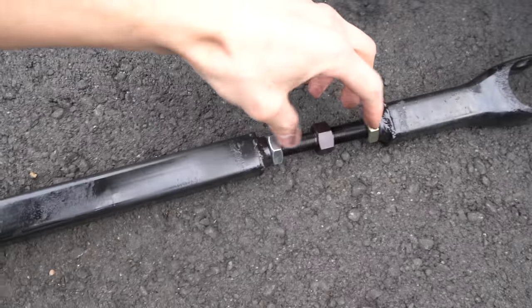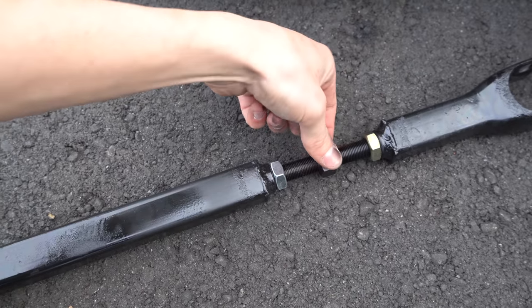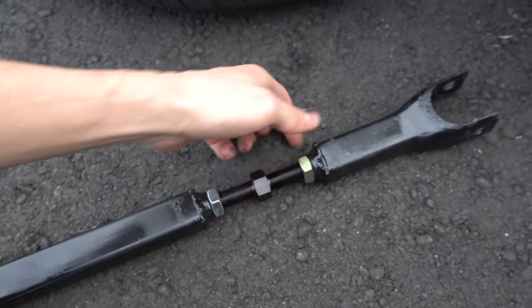Let's throw this into the car. I do want to point out how this is going to lock into place if you don't understand how a camber arm usually works. One side spins to the left, one spins to the right. Since these are going to stay stationary, this is going to move and push this in or out. These outer nuts right here are going to lock it into place. We'll be safe, we'll have the same amount of camber, and it won't move.